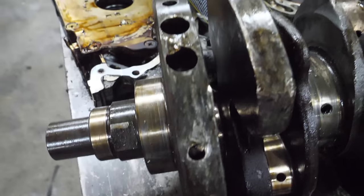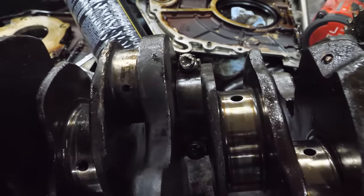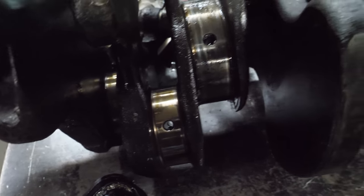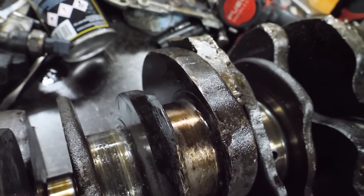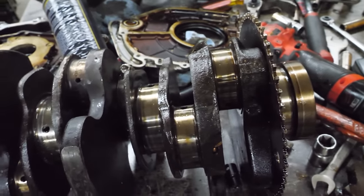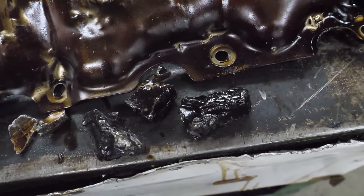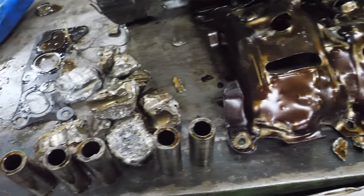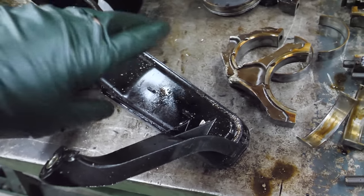Wow. And the crankshaft... Some of the journals on the crank are pretty rough, and I think the culprit is going to be this one here. Because as you can see, this has a nice sheen to it, but this one is very discolored. There's lots of copper transfer from the bearing. It got cooked from friction, lack of lubrication, I believe. And this is likely what's left of that journal's rod. It's all charred, it's like lava rock. It's so impressive. And it technically broke a wrist pin. Wow. Excuse me, we're not done yet.